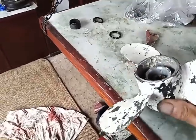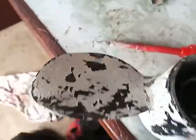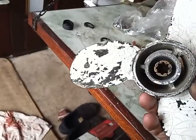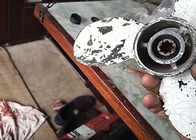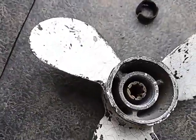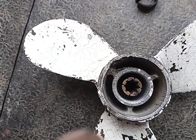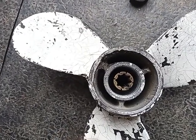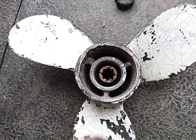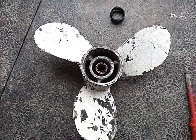I'm going to fix that back in, but first I'm going to put epoxy down around the side here, fill that all out with epoxy, and hopefully I've got a solid prop. I put the bush in and centralised her, but I need to wait for the epoxy to go off a little bit so I can centralise her dead centre and she'll stay where I put her. Then I'll fill all around the outside with epoxy, put the back seal back in, and fingers crossed — backup propeller.